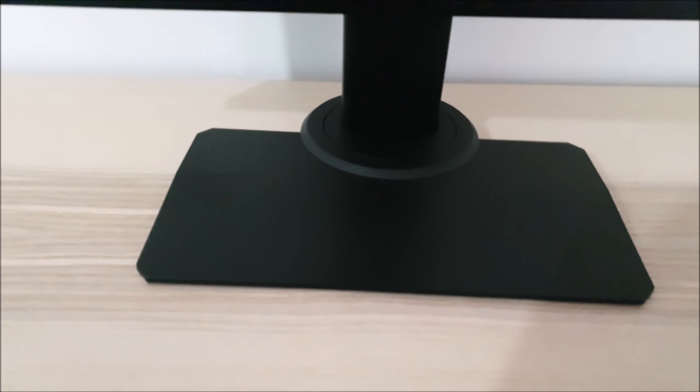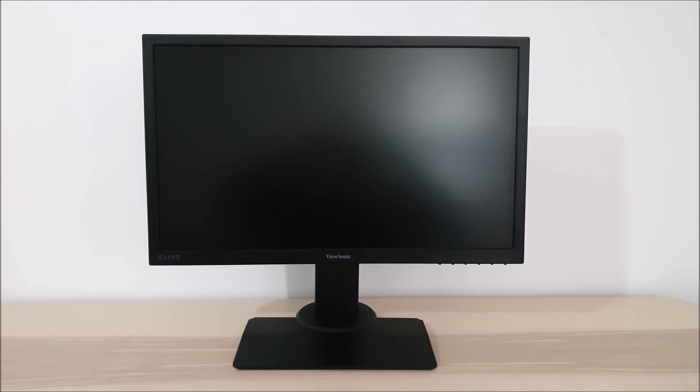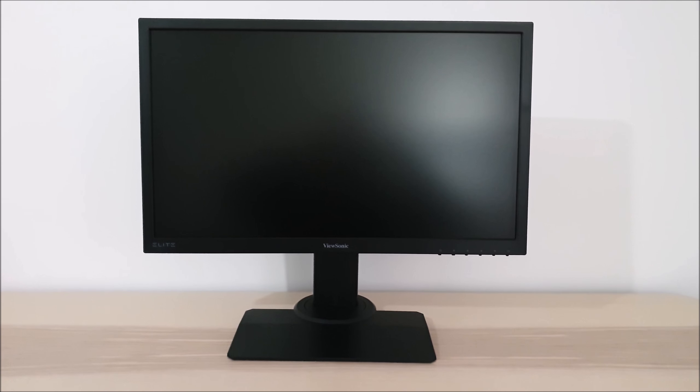The stand has a brushed texture — matte black plastic like the rest of the monitor. The bezels are moderately thick by modern standards, and they don't use the dual-stage bezel design, so the plastic border completely covers the panel border. That's because of the panel itself — it's quite an old panel used on pretty much all 24-inch Full HD 144Hz TN models. The screen surface is medium matte anti-glare, which offers effective glare handling, so you don't get sharp reflections or strong glare from ambient light.